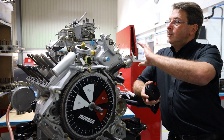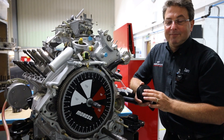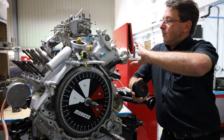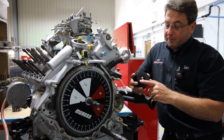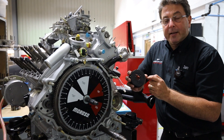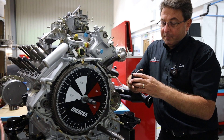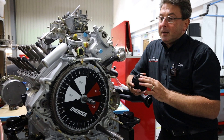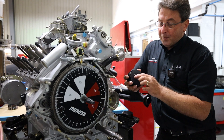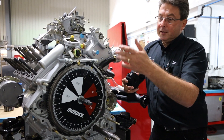How do you change the relationship between the cams and the crankshaft? On a normal hatchback it's all fixed and doesn't have to move. But on any race engine or performance engine there's got to be a way of moving that relationship. Ferrari do it with little pegs in holes — if you need to move the cam around slightly you change which peg it goes in, giving you about four degrees per hole. Some engines have pinch bolts you can loosen, move, and tighten again. Most Ferrari stuff through the 60s uses a peg-type arrangement: take the peg out, move the gear around, put it in another hole, reset it all up, and see whether you're closer to the desired number.